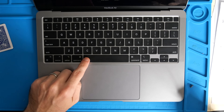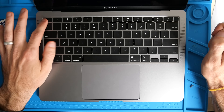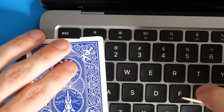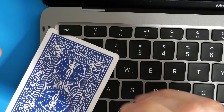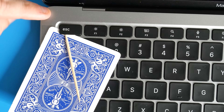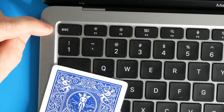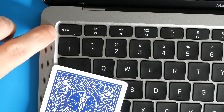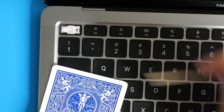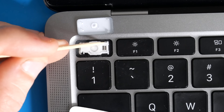We're going to work on this section, the space bar, and I'll also show you the arrow keys. First, we'll remove the top-row rectangle-style key. Grab your playing card and slide it underneath the key to lift it slightly and give you access with your toothpick. Go corner of card to corner of key — that's the easiest way to get underneath. Then pry with the toothpick: put pressure on the right side and pull up on the left side. There are two lobster-claw clips on the left side to release, then push the key slightly right to release the two awning clips and lift it off.